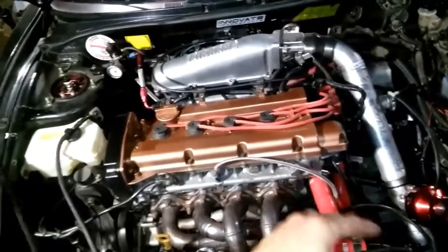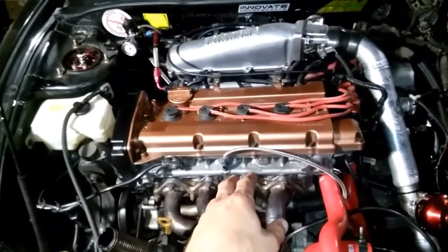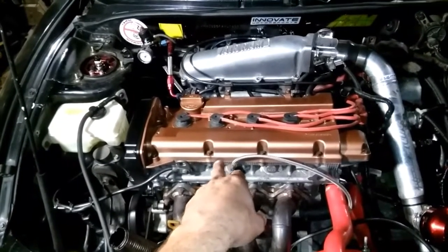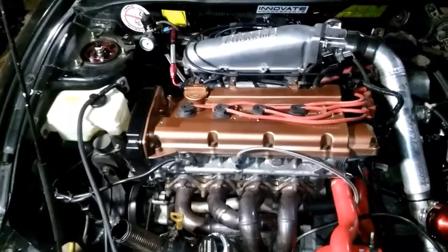System upgrade, thick head gasket. Cuts the compression down. I forgot to say, I think I might have said it, this thing's decked big time, so if you put that on yours, a 10 to 2 engine from stock, it'll cut it down to 8 to 5. That's how thick that gasket is. This one right here, it's probably bumped up about a 9 to 2 to 9 to 5 because that head is decked.